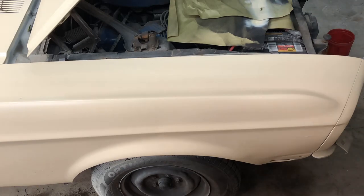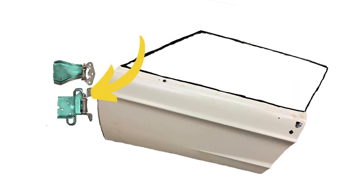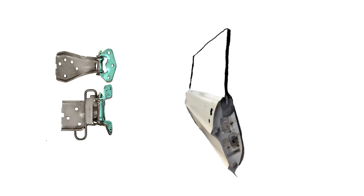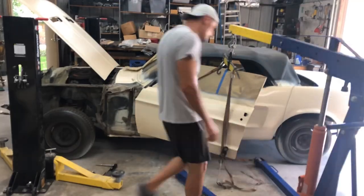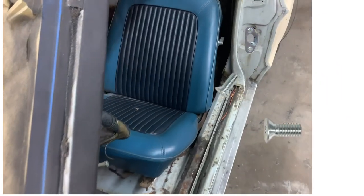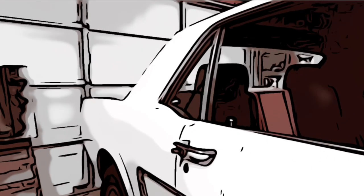It's important to start here and not on the fender side of the door adjustments. With the fender removed, you can easily access all the door hinges, which makes the task much easier. You can adjust the door movements by loosening and tightening the bolts in your hinges for vertical movement, and for side to side or twist you can use these adjustment points. You can even recruit some of your crew members to help you. After you get the door where you like it, reassemble the striker plate, moving it toward the sweet spot where it's not causing the door adjustments you've just made to change. Now enjoy easy click-to-open doors.